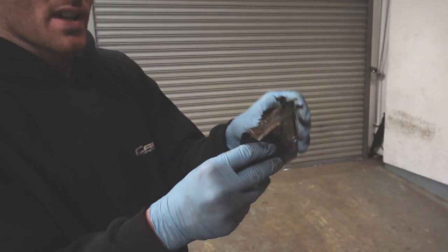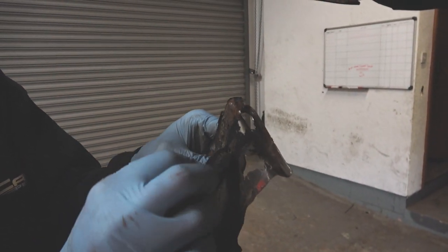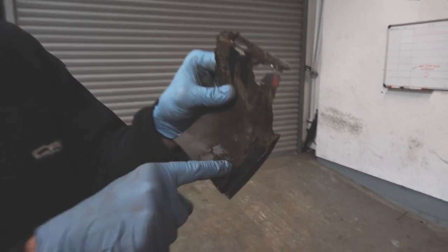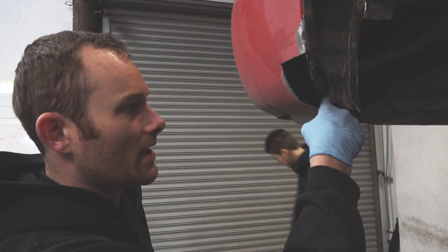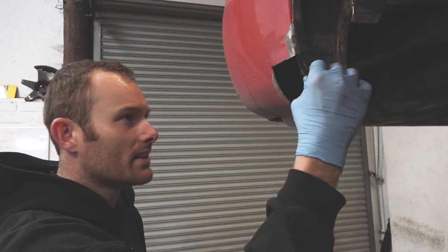So it's all this foam stuff you have on the inside, which is like sound deadening. This is what basically absorbs the water and it just sits in there. And that's what causes it all to rot. There's no coincidence that these bits have got the foam in and it's all corroding around these areas. Yeah, that's what it is. You might have had a small leak in the boot or something like that, and it just causes it to sit in there and that's it. It's just constantly wet and makes it rot away.